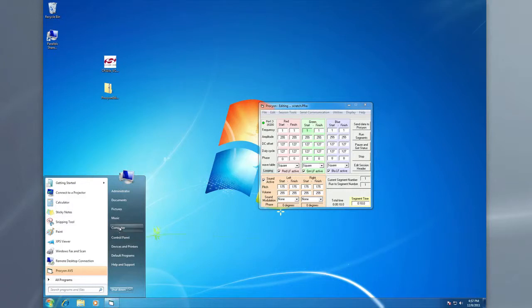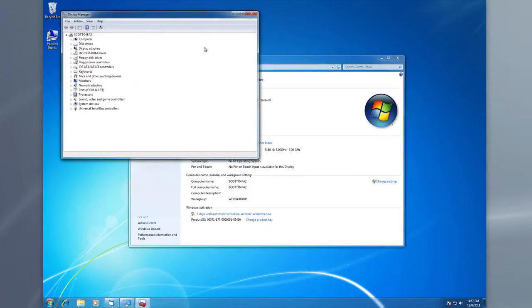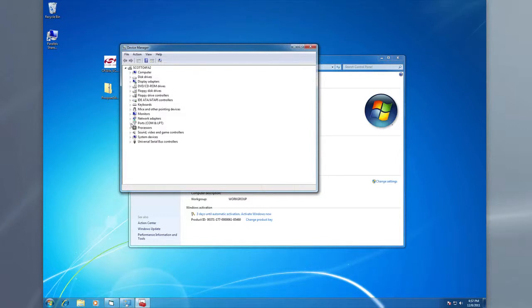Normally the cause is to be found in the Device Manager. An alternate way to get there is to go to My Computer, right-click, get Properties, and get your Device Manager from the top. Back in Device Manager, you will have a warning flag, and normally that's caused by other USB devices that have assigned a number of COM ports already. The drivers need to be within the range of the first 16 COM ports — any port available between 1 and 16. If you've used a lot of different devices on your computer, you might have used up those ports.